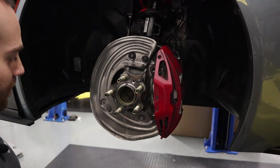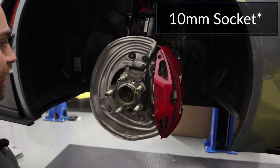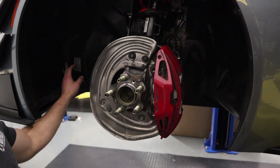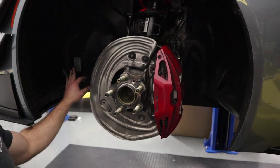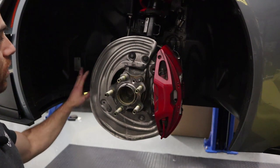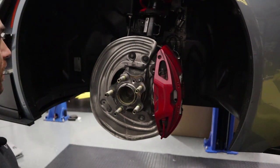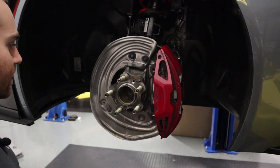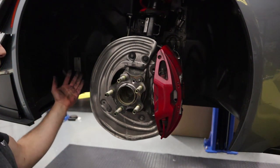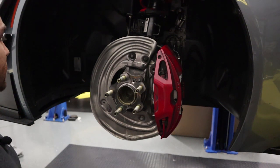We're going to use a 12mm socket to remove the four bolts on the backing plate and then install our new one. You may also notice this is the through-duct from the factory which goes directly to the front bumper — high pressure cool air — basically shoving cool air towards the rotor from the factory. What we're doing is actually force-feeding that air into the center of the rotor. We found through CFD that this air gets interrupted a bit, so with our cooling ducts you're going to see an increase in cooling capacity for the rotor.